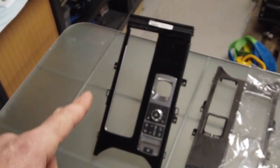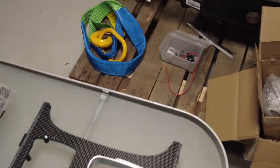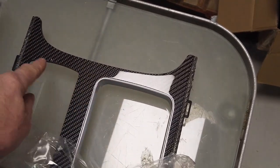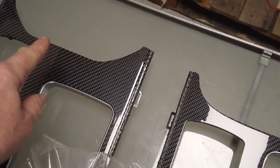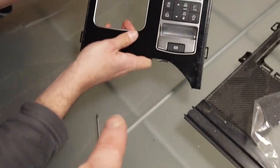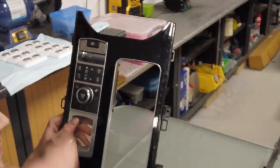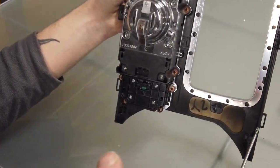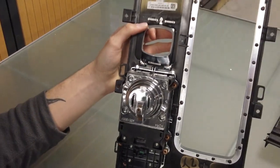Now we're going to do the fascia and show how to take the gear change out. Just to recap: the late type from 2018 onwards has a curvy edge here and these two edges are collinear — in line. The early one, which we're using, is more angled and the two are staggered. So we've just got to pop this gear change mechanism — terrain response module — out. There are orange-marked screws, four on each side — eight in total. Torx T20.